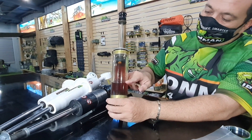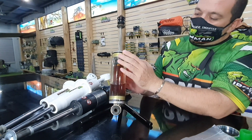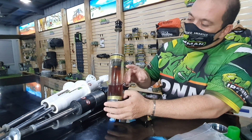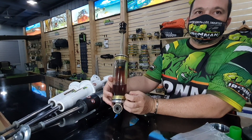The empty space is the nitrogen, and this is the oil. So the nitrogas shock — the shock is the inner tube; the outer tube is purely a reservoir.